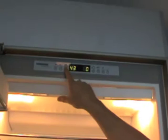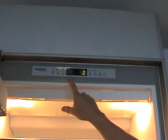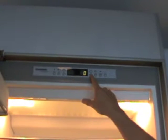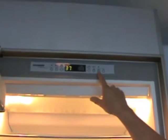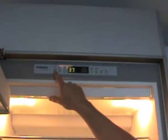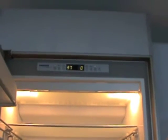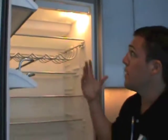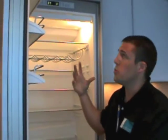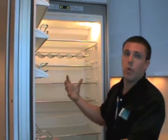It also has temperature controls. You can adjust the temperature up and down with the arrow buttons here. The manufacturer recommends 37 degrees for the refrigerator and 0 degrees for the freezer. It also has a super frost and super cool feature — if you're going to be going to the grocery store and buying a lot of groceries and have the door open for a long time, it's sort of like a turbo charge cool-down of the unit, getting it back to temperature a lot quicker.